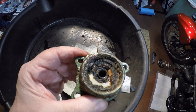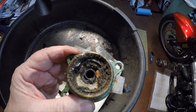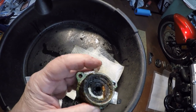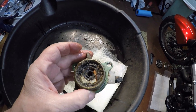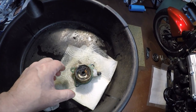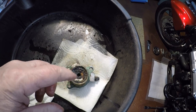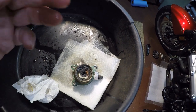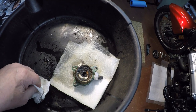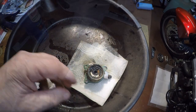I'm going to clean that all out and see if it comes apart - there's probably a plunger in there. There's a rod that comes out of the clutch and goes right in here, then it pushes a rod back through to release your clutch when you pull the handle. Down below it's just about as nasty. I'll be cleaning them, then put fresh brake fluid in - it uses DOT 4, you have to use DOT 4 in that.